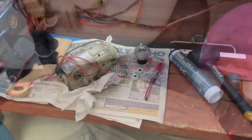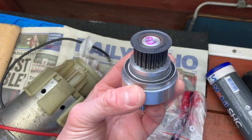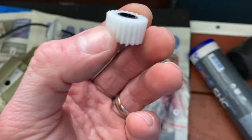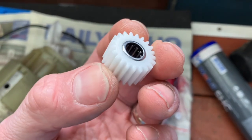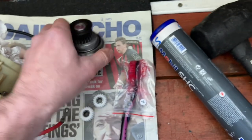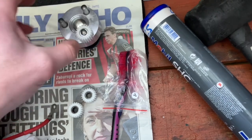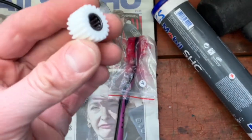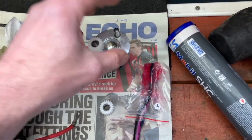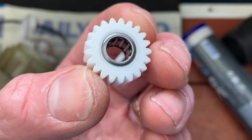I'm now ready to complete the motor build. Thank you very much to Neil Cubitt for this metal insert — it's absolutely beautiful. And thank you to Sam at the C5 Depot who sent parts including his latest professionally 3D-printed parts with roller bearings. The key thing is this flat part here needs to face down against the inserts — that's important. These parts reduce friction significantly, since standard plastic ones on a gearbox generate a lot of heat at speed. These will definitely reduce temperature and roll beautifully.